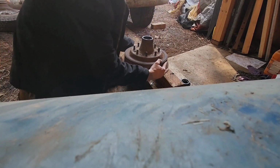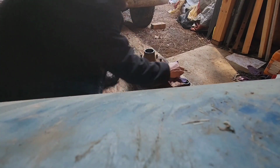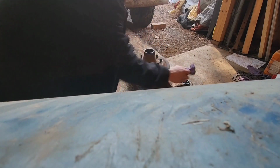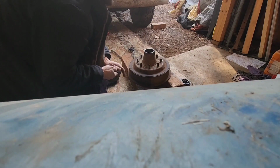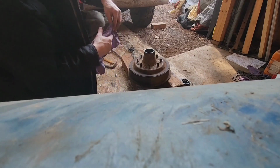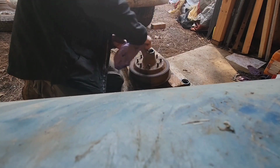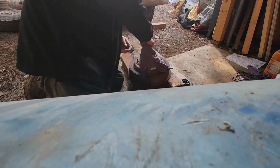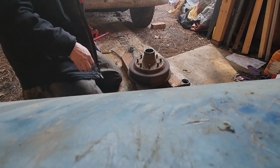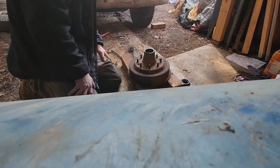But like I was saying, you want to oil them so that they slide in there. The grease is great for, like, joints and stuff, keeping them lubricated, keeping metal from wearing out. But for sliding bearings in, it's not really that good. Granted, you don't want to take all the grease out. You want to leave a little bit there, but you want to use the oil for the main races. It just works better. It's a thinner viscosity, and it keeps it slickery, you know? And you gotta have the slickery, otherwise, good luck. I mean, you saw how much I struggled with just that one.